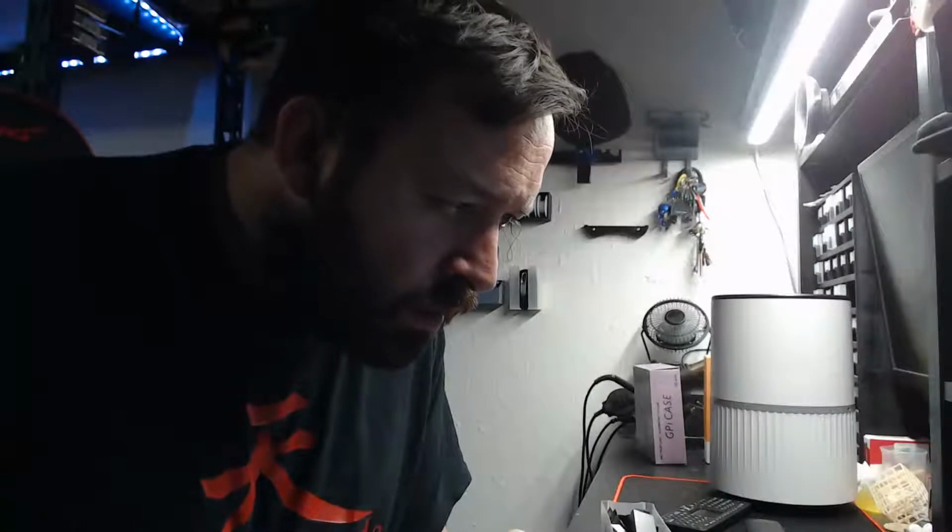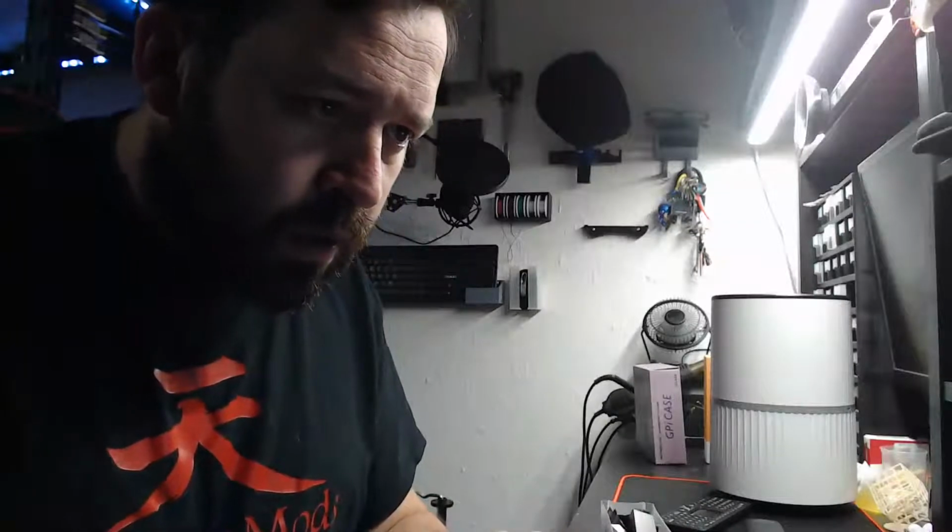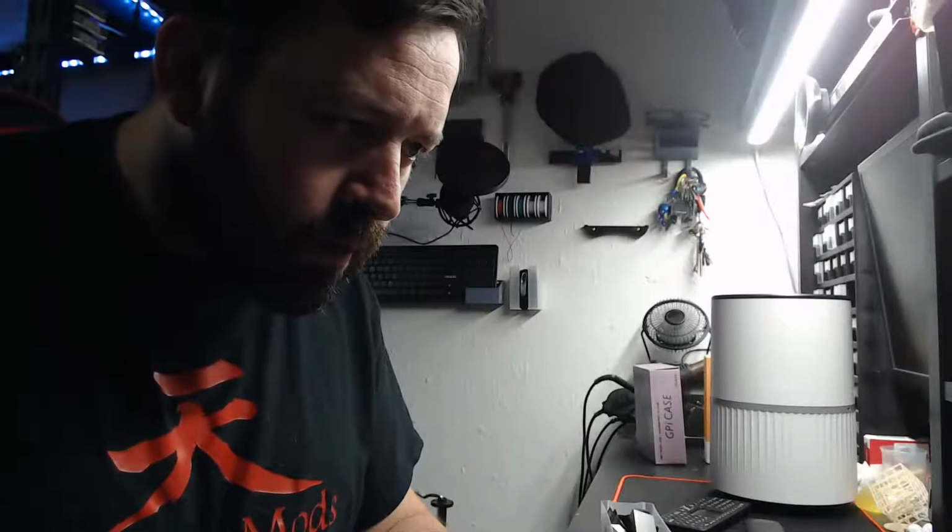First thing I'm going to do is actually run a benchmark with the stock CPU speeds, no overclock at all. Then we're going to run a benchmark at the new overclock of 1.57 gigahertz. All right, so here we are, Raspberry Pi. We're going to go ahead and copy this, and we want to find the max frequency that we're in right now. There it goes. This is going to spin up the max frequency of the CPU: 1.4 gigahertz.